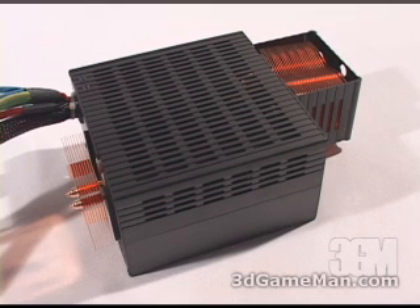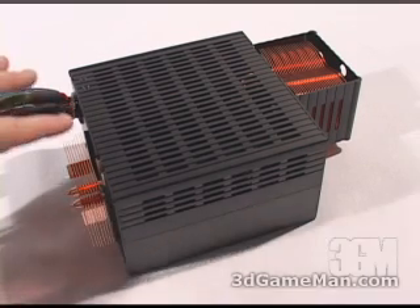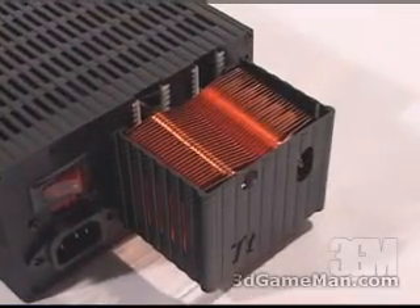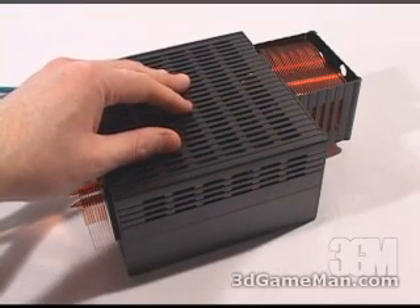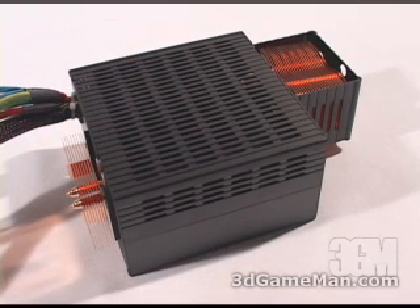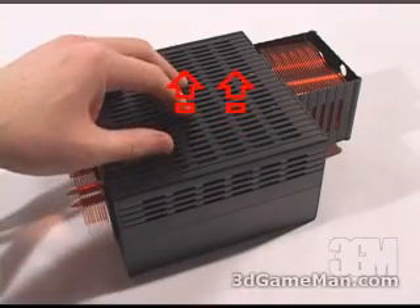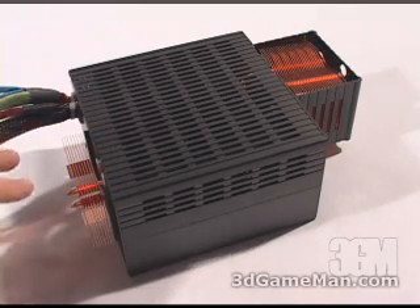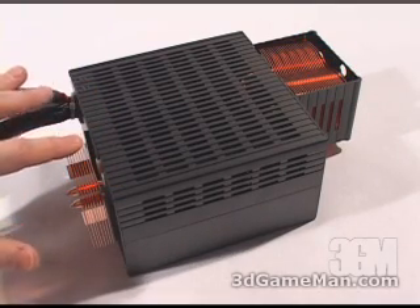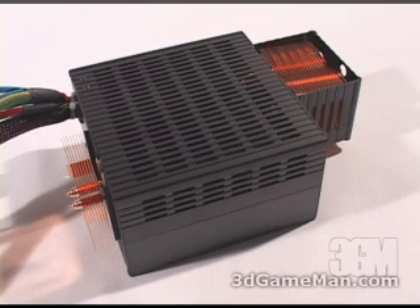This product is very unique and completely silent. It doesn't have any fans, and it doesn't need them because it has these copper fins that are on each side. They are connected to copper heat pipes, which in turn go to the inside of the power supply being connected to heat sinks. So the heat will start on the inside of the power supply, be radiated by some of the heat sinks on the inside, and the remainder will be transported through the heat pipes to the outside copper fins, which will dissipate the remainder of the heat.